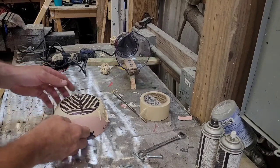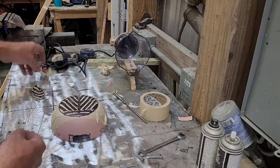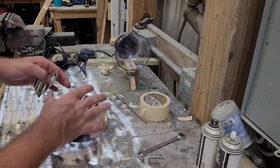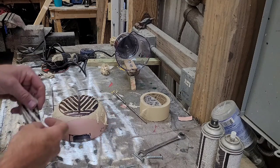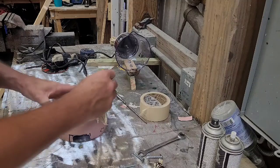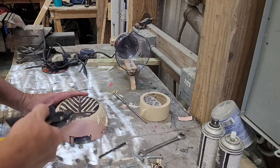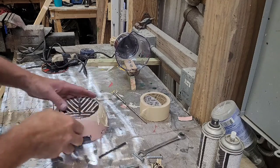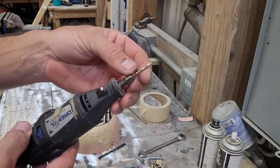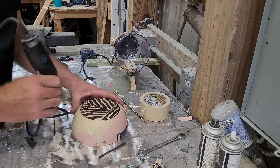I'm at the point where I'm getting ready to cut it out. This part really is where you have to find your innermost patience. I traced it and it just wasn't lining up, so I take a razor blade, cut that tape off, put another piece of masking tape, and do it again until I got them as close to being symmetrical as they possibly can be. You really got to find your inner patience and work with it. All I'm going to do is take a drill bit and run it in each end of it. Now you can cut this out a couple of ways — you could use a pair of snips, get inside and snip it out; you could use a razor blade and score it after you drill your holes. What I'm going to use is a Dremel with one of those little side-cut style bits. Once I drill my holes, I'll come in and go right around my lines and cut all those out.